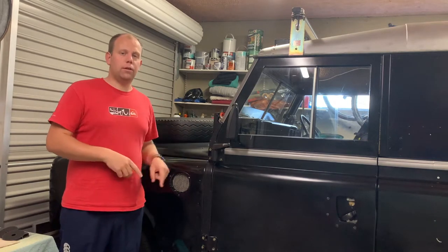In terms of finances I'm going to have to split that up into a few jobs. I've got some springs on order and they're going to go on, but in order to do that I need to get the front axle off, remove it from the vehicle, get it all cleaned up, painted, get the springs off and get ready to put the new ones back on. My main concern is the suspension as there seems to be excessive wear in the bushes and the front springs are looking a bit tired.